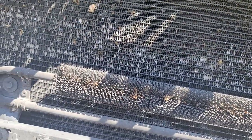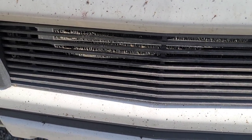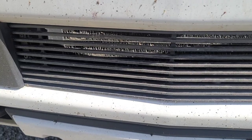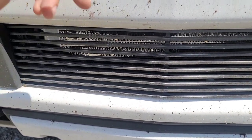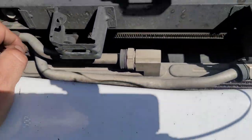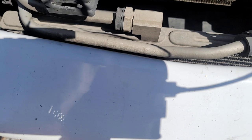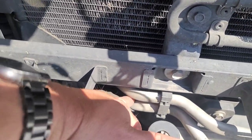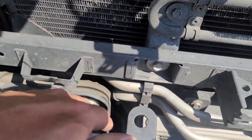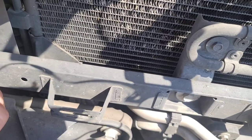This little lower grill insert — a lot of people don't see the significance of why they need them. Shame on GM for not putting that in from the factory. I've been a Chevy man my whole life, but they're making it hard. If you look down here at the transmission cooler, you can see how beat up it is from before I put the grill in. These are the transmission cooler lines that they say will rub and get a hole in them, and I can see that it is actually touching — it shouldn't be touching. So I'm going to take a closer look at that and address it if needed.